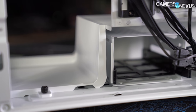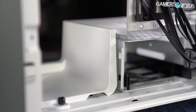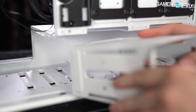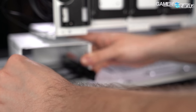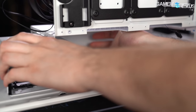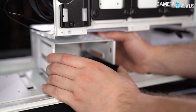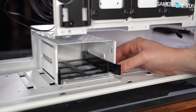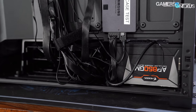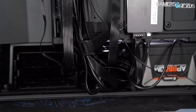With a power supply mounted in the standard fan-down orientation, capping or uncapping the end of the PSU shroud has no real impact on the power supply itself. If anything, blocking the end of the shroud is just another obstacle to airflow depending on where your front fans are oriented. The hard drive cage may be mounted in three locations, but the rearmost position gives barely any wiggle room from an ATX power supply, and using the cover plate basically eliminates support for 3.5-inch drives.